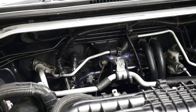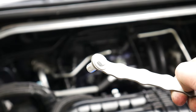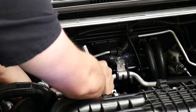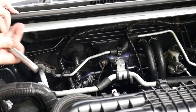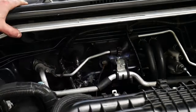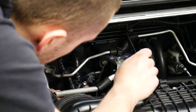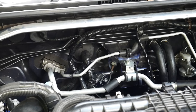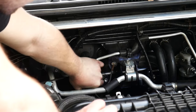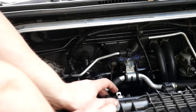Let's go ahead and get onto those rivet nuts. I've got my rivet nut tool set up right here. Got the nut, washer, and bolt — there's a flat rivet nut. We got both nuts riveted in. The driver's side one is a little more difficult to get to. You can see them both right there. Let's get on with this install.